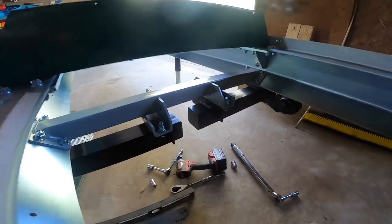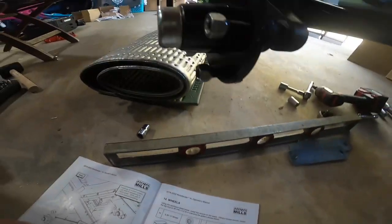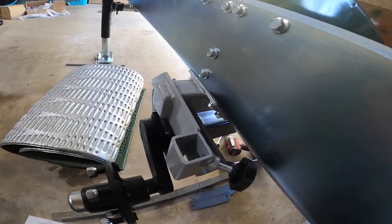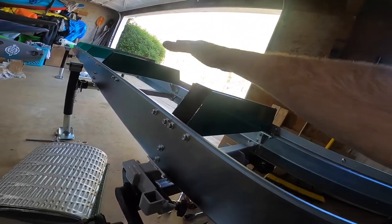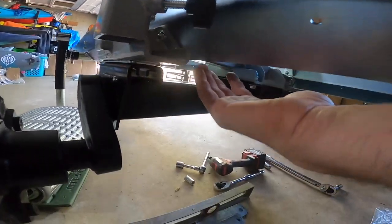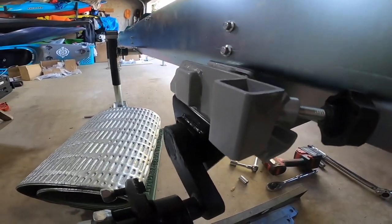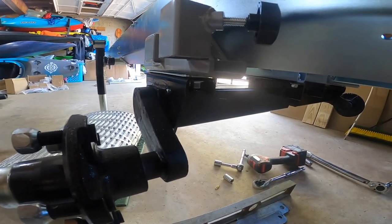That felt like a milestone - I've got both axle assemblies on. These 12 millimeter by 35 millimeter bolts torque down to 93 foot-pounds, quite a bit more than the 53 foot-pounds. You have to get your trailer dead level front-to-back and left-to-right, then snug these up - a bit of a pain by yourself. Put a level across the bottom of the axle assemblies and you may need shims on the outside; I needed one shim per side. It says you can put up to three per axle assembly but I only needed one and everything's dead level.